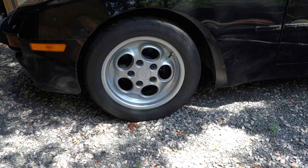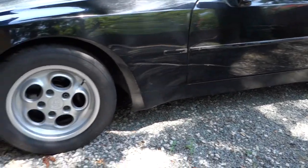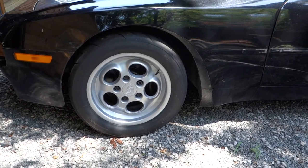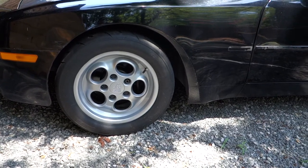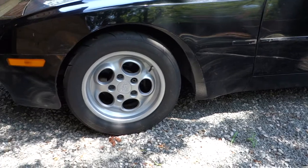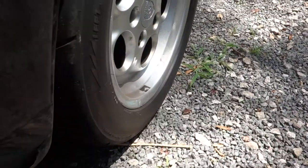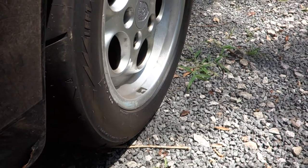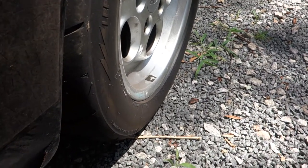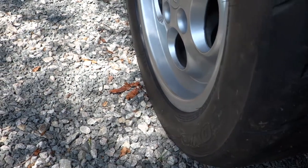I filmed this out of order since the wheel is already painted silver to match the back, but I wanted to do an overview of why I needed to paint it. I sourced a second set of wheels — these are 16-inch phone dials. My originals were 15 inches by six and a half, and I wanted the 16s for autocross. I couldn't get four wheels the same; I wanted four 16-by-7s but ended up with two 16-by-7s and two 16-by-8s. You really can't tell much difference in the tread sidewall — that's a 225/50/16 versus the original 215/60/15. You can see the 225 on the 8-inch wheel sticks out a little more than on the 7-inch, but it's not much difference.